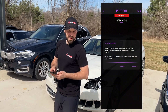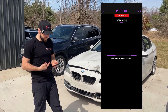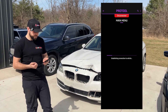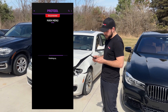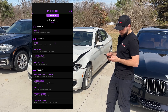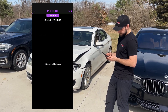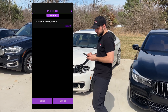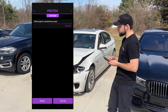I'm connecting to this 535d with Pro Tool, establishing the connection. We're identifying control units and we're connected. Going to live data again, then raw data — and this offset of this timing chain is negative 0.5 degrees. I would say that's perfectly in spec.